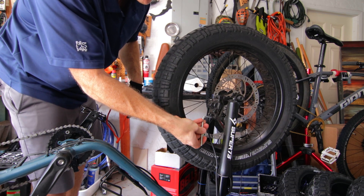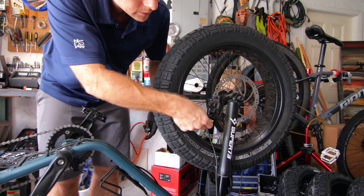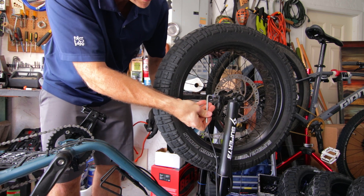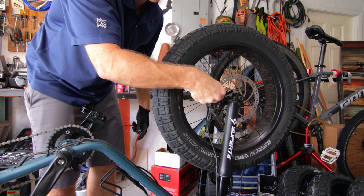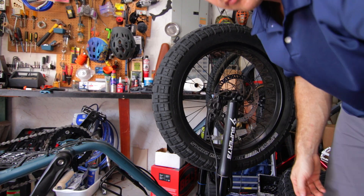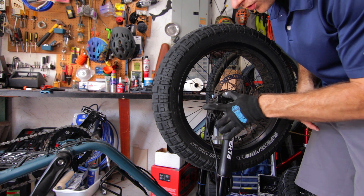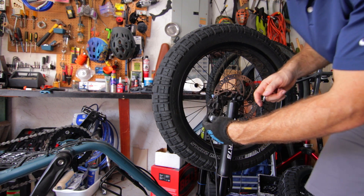For a lot of you, if you're going to do this job, I recommend doing it in one sitting. Don't leave your bike upside down — you'll get some of the shock fluid out of your front suspension, which could start to leak down your stanchions. You want to keep all the fluid you can in your front suspension. When you reattach the front caliper, there's this spacer which keeps the caliper further up the rotor so it's not pushing against it too much.